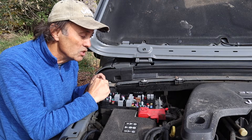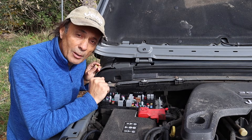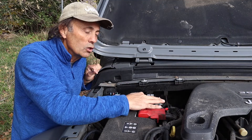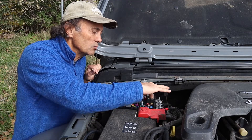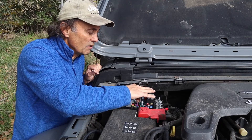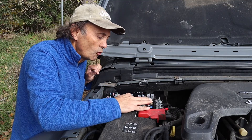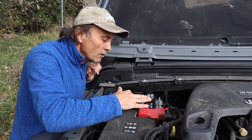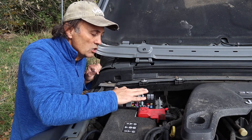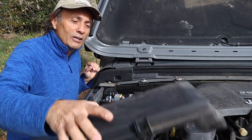I would be remiss if I didn't mention that in the forums a lot of people have suggested that, to help avoid some electronic gremlins that some people have experienced in their Wrangler JLs, you go and make sure you press each of the fuses down — and press the relays as well — making sure they're all seated properly. They're all in nice and tight and they don't click because they've all been seated all the way in, but I'd recommend you go ahead and do that. I'll put a link in the description to those forum threads where people talked about that and suggested it seemed to resolve some annoying minor electronic gremlins they were experiencing.